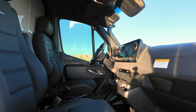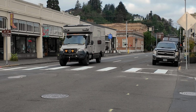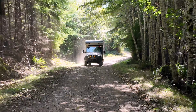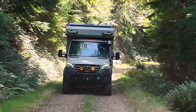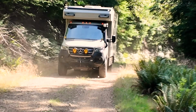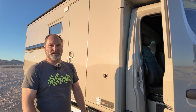We added a DDC suspension, and that also helps this high and heavy chassis to perform perfectly on-road and off-road. 7 sensors under the car, on the wheels, and also body roll sensors are measuring. All the data goes into an ECU unit, and we always have the perfect stiffening of each individual damper, so that helps also larger and higher vehicles to really stay safely on the road.